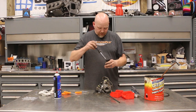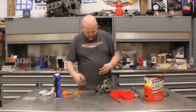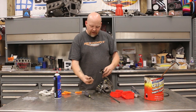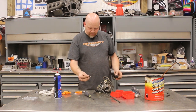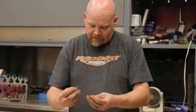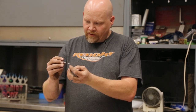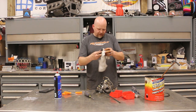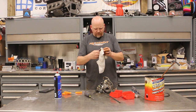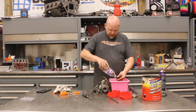And there we go. So to get to this, I'm going to use a nut driver and it just gets a quarter turn. And that little cap will fall out. Then we can pull this piece out and that gets replaced with our new beefier one. Start cleaning these parts real carefully with our carb cleaner and a towel. I'm just going to use a water bottle with a hole popped in it to rinse it.